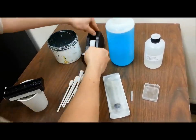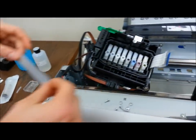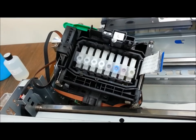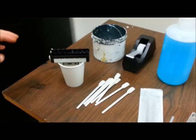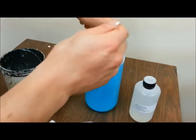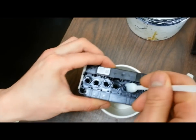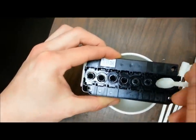Next step: get some scotch tape — nothing special, just normal scotch tape. The scotch tape is here to cover your dampers so no excess debris or dust goes into them, because it will lead back into the printhead and might cause clogging. Once you tape your dampers, get your exposed printhead on top of a cup. Reach for a swab, dip a little bit of clean solution — no double dipping if it's stained — and wipe off the nibs of your printhead. There will be a lot of ink residue, and you do not want that to dry, so give it a good clean.